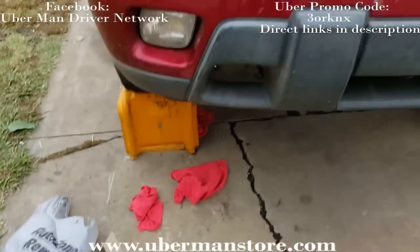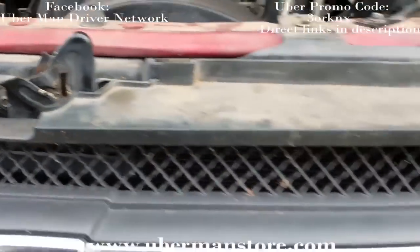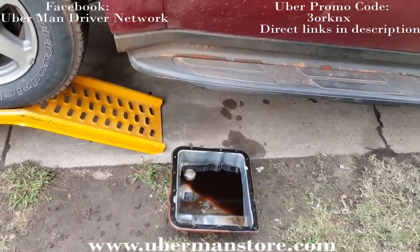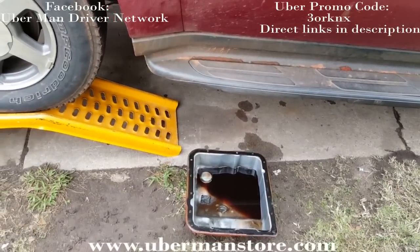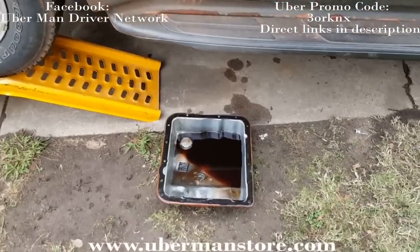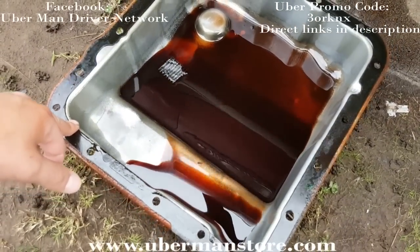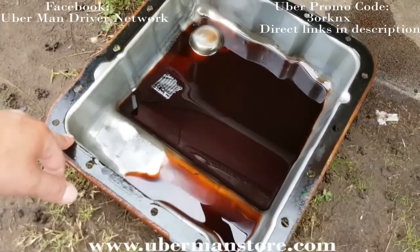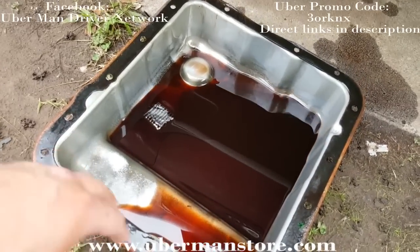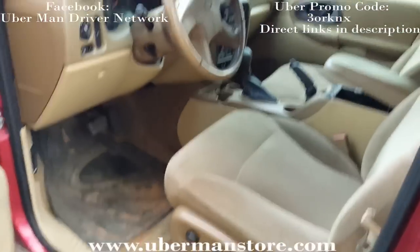There's really not much to it — get the thing up on some ramps, change your transmission fluid and filter, and a lot of times you won't have issues like this down the road. On normal vehicles, most people do not know this, but you should have your transmission fluid and filter changed every 30,000 miles. There are people that go — like this Trailblazer — 160,000 miles without ever changing it because they don't even know they're supposed to. Looking at this fluid, it's dark but it hasn't turned completely brown and it definitely hasn't turned black yet. That's when you know the transmission has been severely neglected. So somebody has taken care of this — either that or the transmission has been replaced.